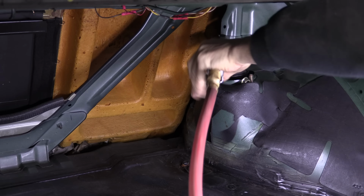And this is actually separate. Stood it on there. Could use a new boot, but the joint's good. It's pretty much the same story everywhere. At the very least, we're going to take all the all-wheel steering stuff apart. I'm going to check out the rest of it to see what it looks like on the inside, because one of the lines was open and turned upward, and when I tried to turn the pump, it pushed some water out with the hydraulic fluid. So it could be rusted up on the inside. I don't know, and I won't know until I get in there.